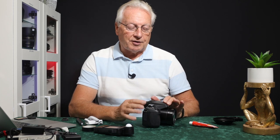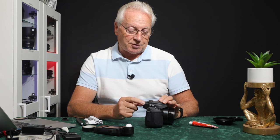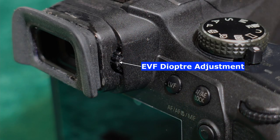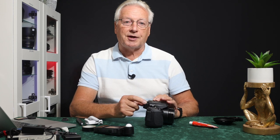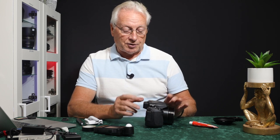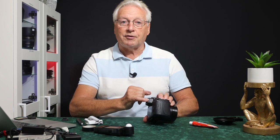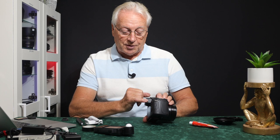You may find that when you're using the EVF or the eye level viewfinder, the focus goes out of adjustment very quickly. There's a little adjustment knob on the side of the EVF which allows you to change the diopter strength to match your own eyesight, but because of the flimsiness of this mechanical device it goes out of focus very quickly.